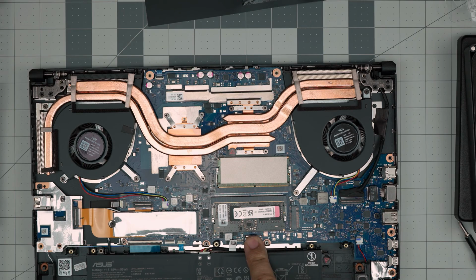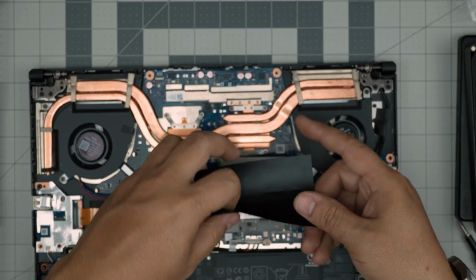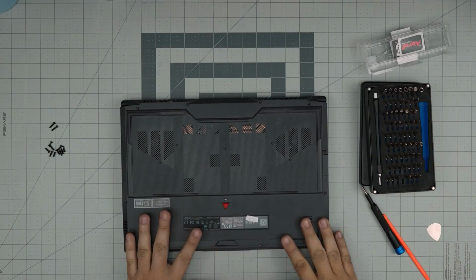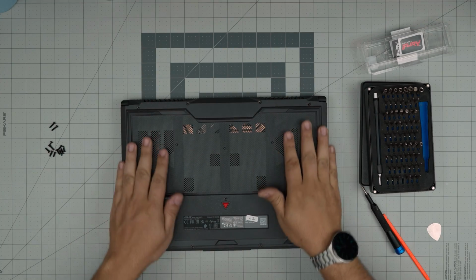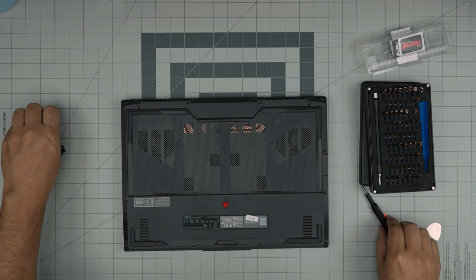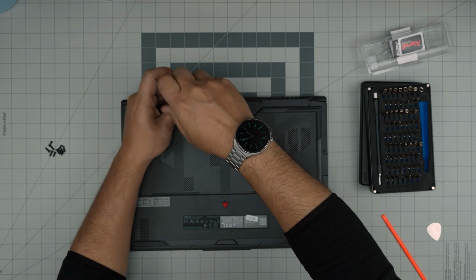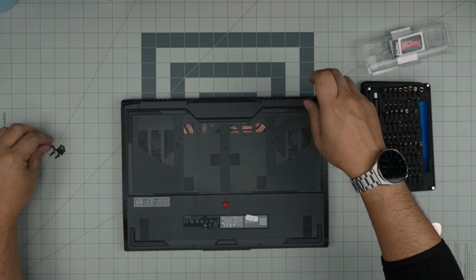If you have disconnected the battery, plug it back in. Put this shield over. You want to grab that bottom cover, bring it over. Then you want to just push down the corners. Make sure you hear those nice, sweet click sounds. And the last thing would be to put the first 2 long screws at the back end. I recommend you put the corner back ones first.